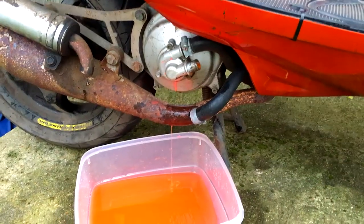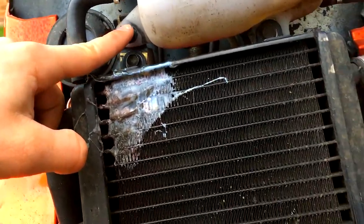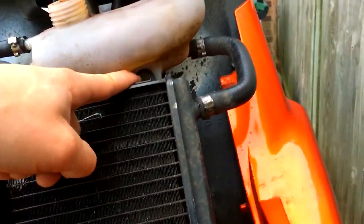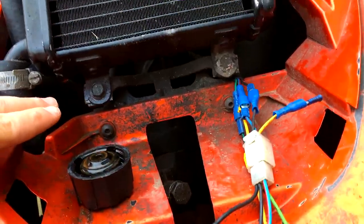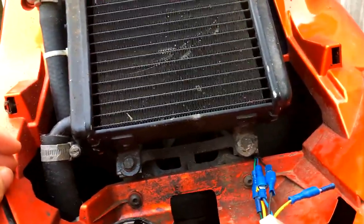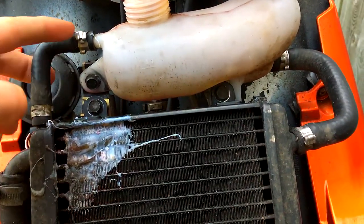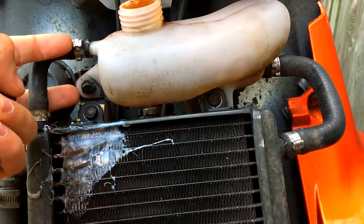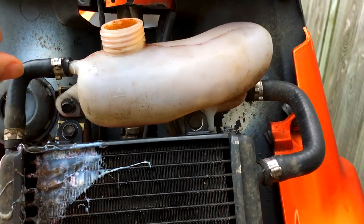Once you've got most of the coolant drained out, come up to your rad. You've got one bolt there, one bolt there — you can leave that one because that's just holding the rad to the bottom — and you've got two bolts at the bottom here, size 10. Just undo them and then if you haven't touched it before you will have these clips, which are one-use only. You can put pliers on them and twist them to get them off.